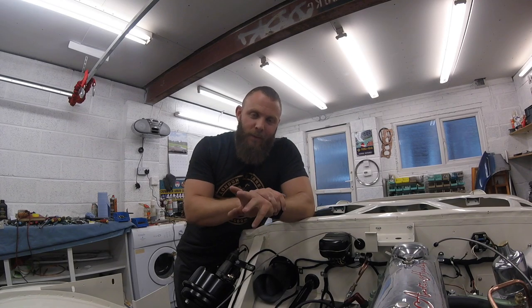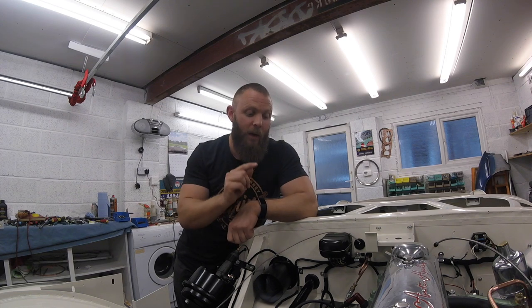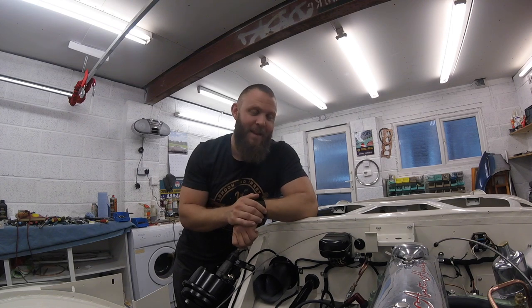First time — not so lucky. It turned, it turned, but we had no spark. We started looking at points and voltages, and after all day — literally all day — chasing voltages and many phone calls, shout out to Dave Norris with 40 years of Healey experience, and Andy Robbins — massive result. We had a problem with our isolator. We went for a more modern style isolator as opposed to the older style, which was grounding the lead that went to the points, causing us not to have any spark. That rectified, we try it again.